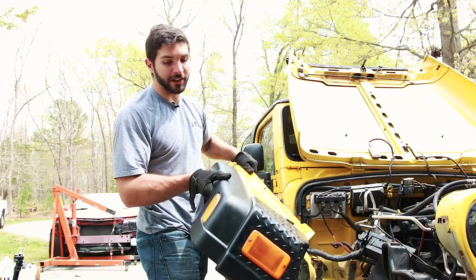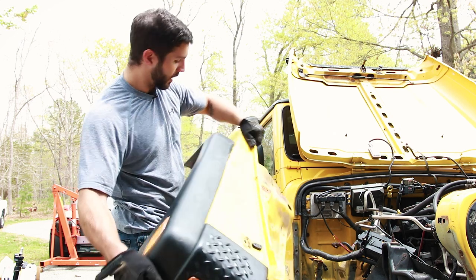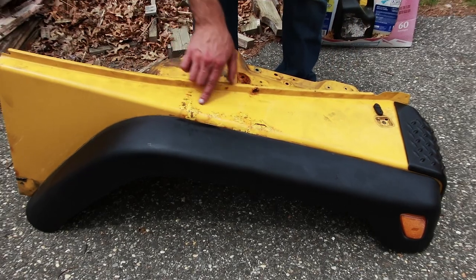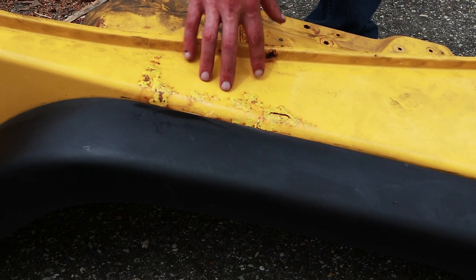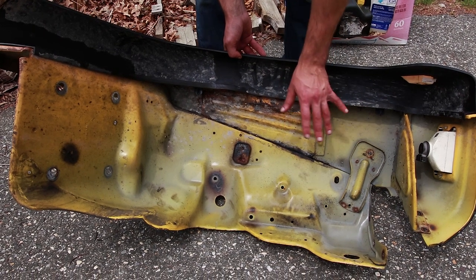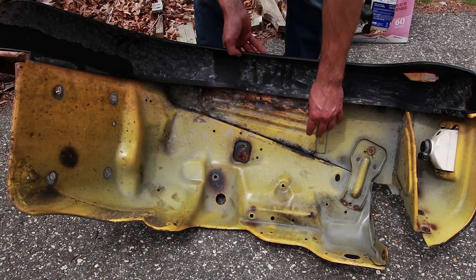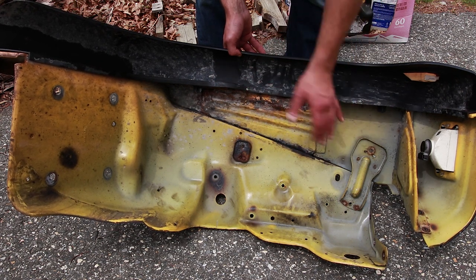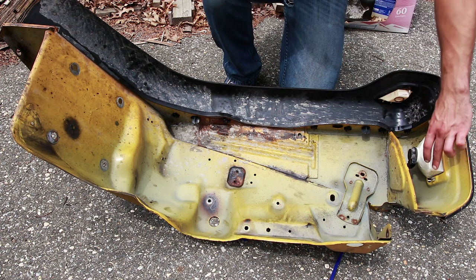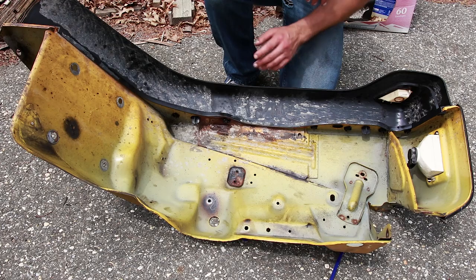The fender is off. Now that it's off, we should start removing the accessories like the fender flare, and we have a diamond plate cover on the top front corner, so we'll take those off and start putting everything on the new fender. These Jeep fenders are notorious for rusting out generally in this spot right here — you can see it coming up from the bottom all the way to the outside. The reason is that from the factory, these Jeep fenders have a piece of metal welded right here for structural support to stop vibration, but moisture can get under there and they don't do a good job of getting primer between it at the factory. So the moisture sits and stews, creating corrosion, and slowly but surely these fenders die. We have 10 screws holding the fender flare on, two screws holding the corner light on, and one screw on plastic thread holding the flasher light on — 13 screws overall.